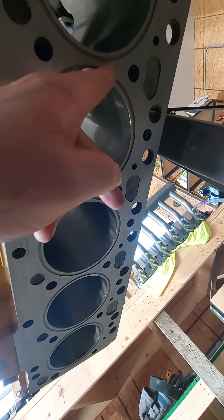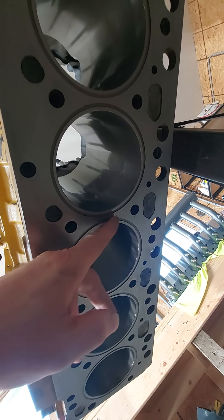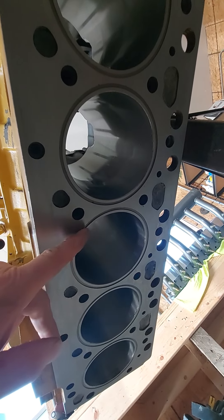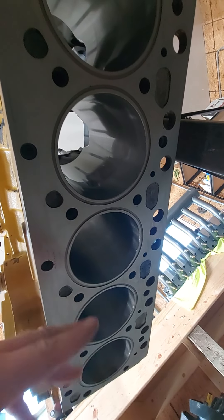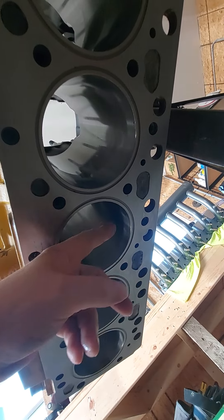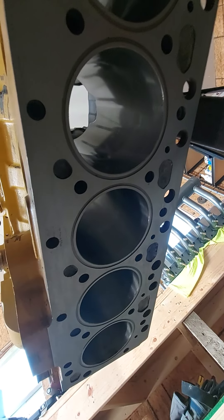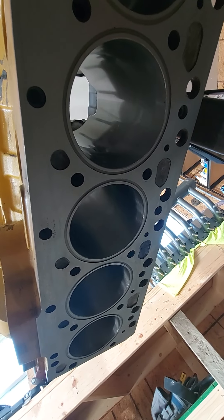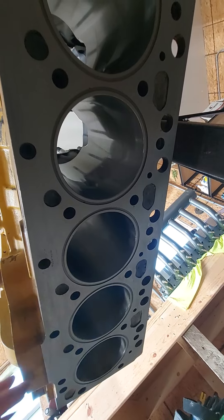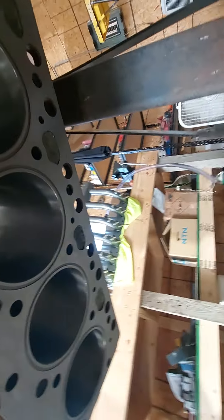On the underneath side you can see these grooves. We're running what they call O-rings, fire rings — you insert metal rings into these grooves and the head gasket goes on the outside of them. When you push the head gasket on, that ring gives you more strength and just a better seal overall. When you're running 80 pounds of boost, that ring takes the abuse of the intake manifold pressure. This motor is bored out 40 over — that's about the max you can go on a 5.9 Cummins block — and the block is machined completely flat with no imperfections.